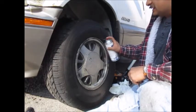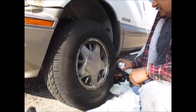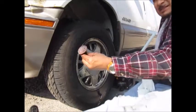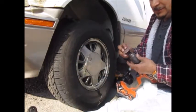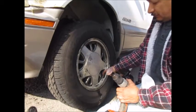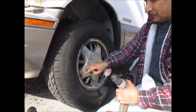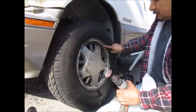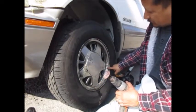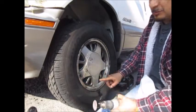You've got to wash it off really good. This Pre from Eastwood is a degreaser. I'm just going to wipe it down right here. After I degrease it, I'm going to put the attachment on my drill. I'm not interested in removing the gray — I want the gray to stay on there. Right now I'm focusing on this outer lip. It was hard to get in here; I actually did this section by hand with sandpaper last time because I didn't want to take off the wheel stem and tire. So I'm going to wipe this down really good with the Pre. You can see it's coming out pretty well, but then you've got all this chipped gloss — that's what I'm going to be sanding off.